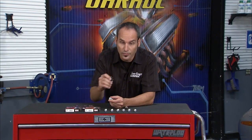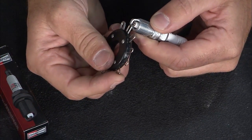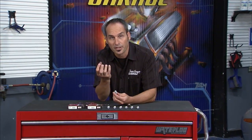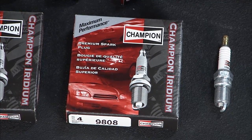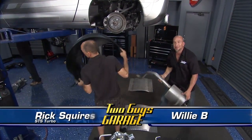With so much more fuel and air, it's definitely going to get hotter in there. We close the gap down to make it spark a little easier with all that extra dense air and fuel — use a simple tool to fold down the electrode, then check the gap. Heat is important in a spark plug for ignitability; it helps get that initial kernel started. But too much heat causes pre-ignition and serious engine damage, which is why we're dropping the heat range. The Champion Iridium is a premium hard material giving real long life and a fine wire tip to absorb heat — perfect for a lot of burnouts.